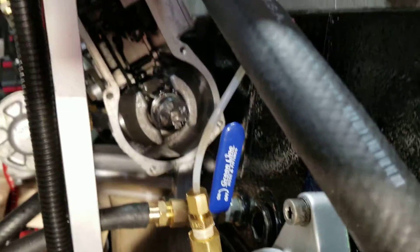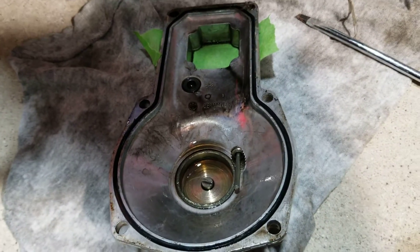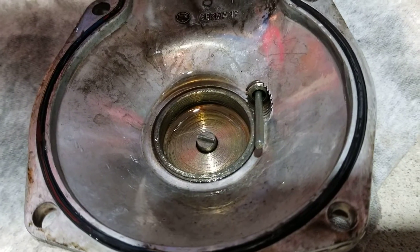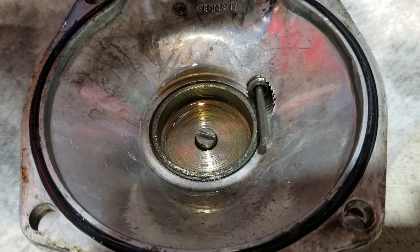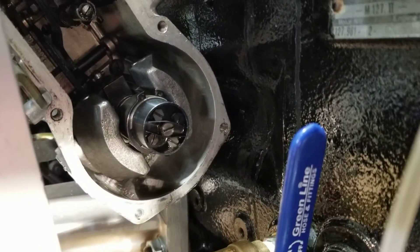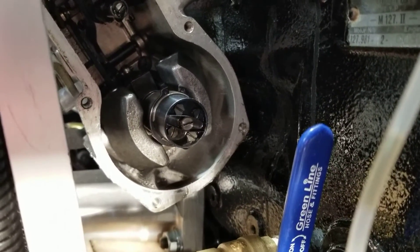I had to take off the backplate because I simply ran out of adjustment. Here is the plate itself, and as you can see in the center, you've got that adjustment screw - the slotted screw that you push in and adjust click-by-click for your lower end, for the idle. That goes right here. Now you see how important it is that you don't touch that when the engine is running.